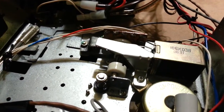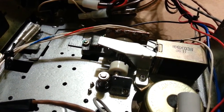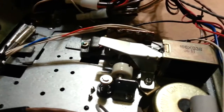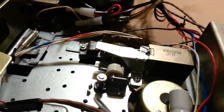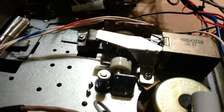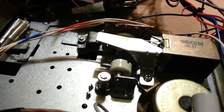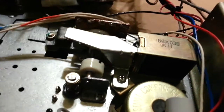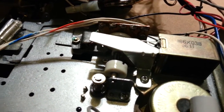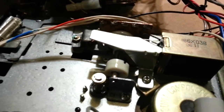With the piston jammed, it couldn't change programs at all, no matter how hard that camshaft pressed against it. This is completely mechanical — I believe the solid state designation of this unit means that it's entirely mechanical on the drive here. You have to rely on just a little bit of tension from pushing the program button, which then drives the solenoid to pull up on that camshaft and rotate it. If it rotates and it can't move that piston, no track change.